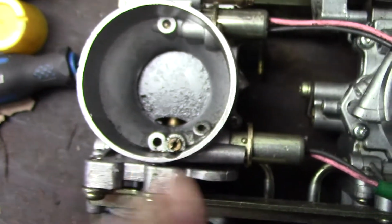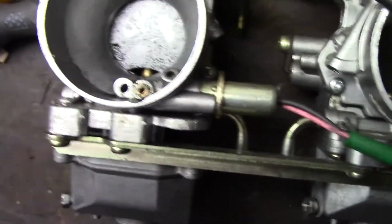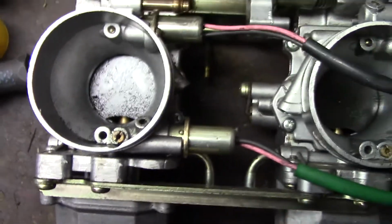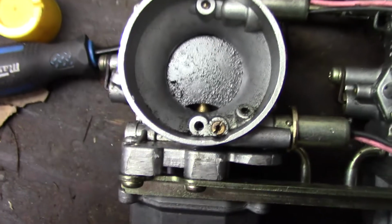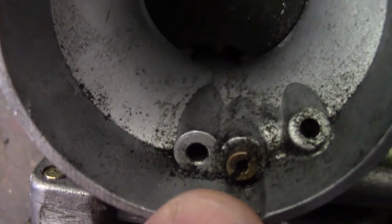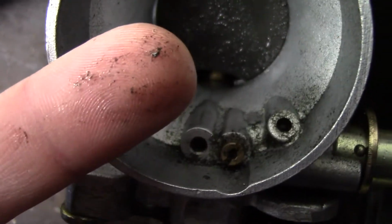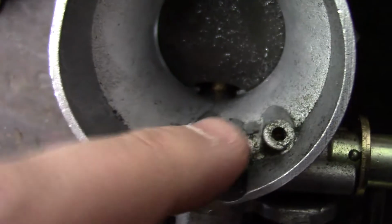The thing with snowmobiles is you're not in a dusty environment, so they usually don't have an air filter. It's usually vented to the outside. It's like a marine engine, like a boat. You don't really need an air filter on it. If you look down here, most of that is just belt dust, because that's the only real thing that can get in there.